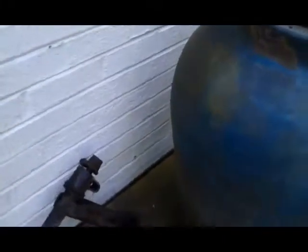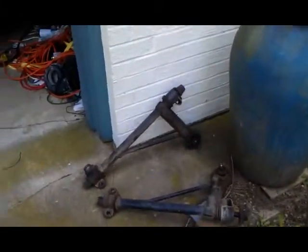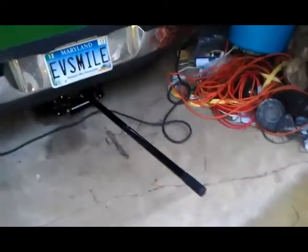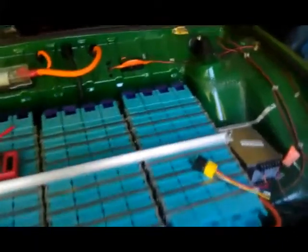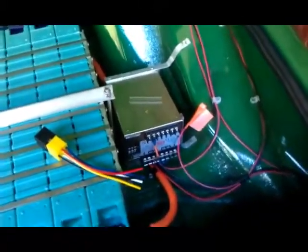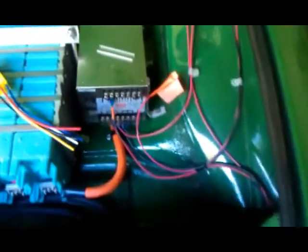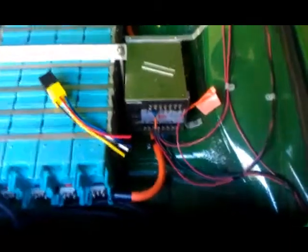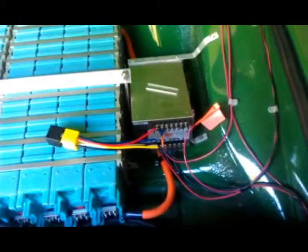This one right here needed a new joint, so I got one of those too. I've yet to put them on the car. In the ensuing three months my 914 just sat here in the garage. And like Jack says, you really just have to do stuff to learn. What I learned was that I wired my DC-to-DC converter directly up to the Soliton, so it's not going through the shunt and not being metered — that's not good. And secondly, it has a jumper that makes it permanently on. You can make it switchable, which it needs to be when the ignition's on. I got a relay, so the project at hand is to make this DC-to-DC converter switchable.